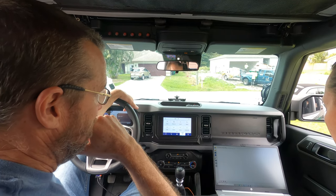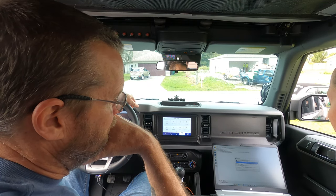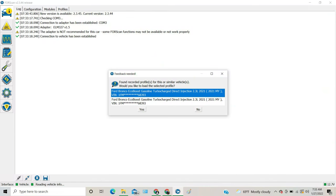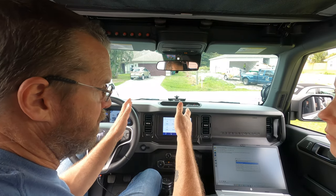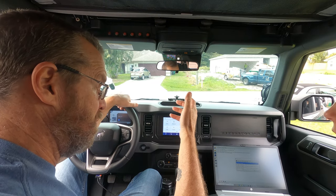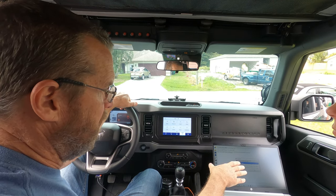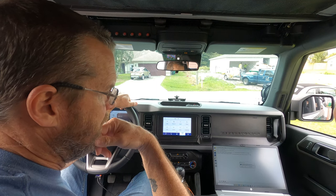In the bottom left corner, go ahead and click on the icon to connect to the vehicle. It's going to show your last save point — you don't want to modify any of those because these are your restore points. If anything goes wrong, you can always revert back and load one of the restore points. This is a very important step. Right now we're going to pick 'No' because we're not going to actually revert to a prior restore point.